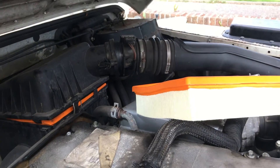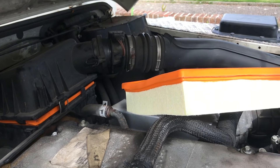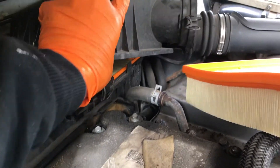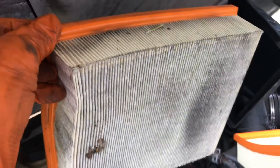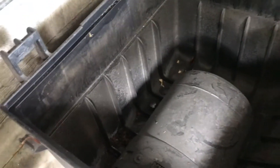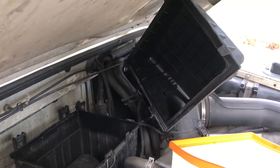Whilst the oil is draining out of the sump, might as well get as much out as we can and do the air filter. Just pop the clips — there's one there, one on the other side, two here — and put the lid out of the way. This should just lift up. There's the air filter, just lift it out and put the new one in. That's only two years old, there's not much in there really. But I'm going to clean out what's down in there and give it a little hoover out whilst I'm here, take out all those bits, then pop the new one back in, do them all back up. Easy.